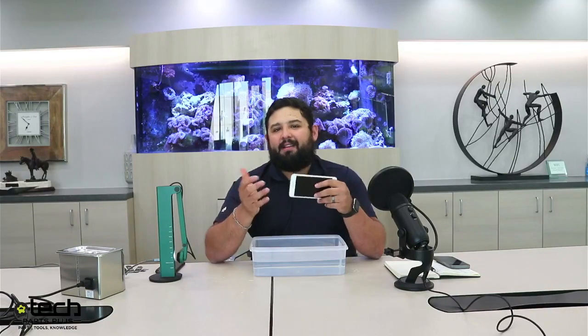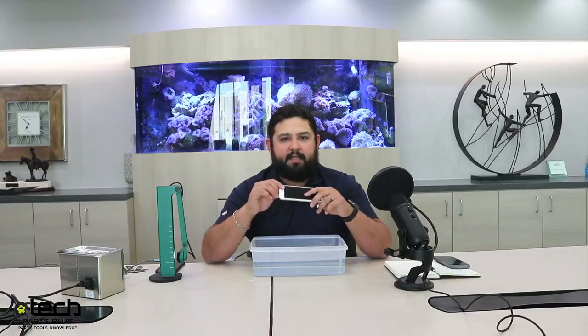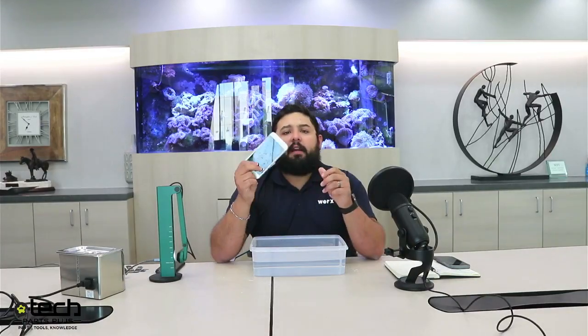If in absolute worst case, say you did just drop it in a river and you got it real quick, or a tub or something like that, and you don't have a repair shop near you, or it's late hours, dry it out for at least 24 hours. Maybe put it in the sun, just somewhere where it has indirect heat that's heating it up. You don't want to go extreme, like put it into a heating bag or a heating pad or something like that. I would take that to a repair shop and they can do something for you. And I'll get to what to do on the repair shop side in a second. But again, if you follow those things, as a user, you're going to have the best likelihood of at least being able to access your data, which is usually the preferred thing, or getting the phone fully functional.